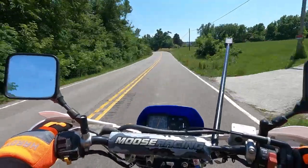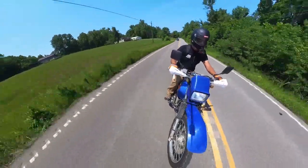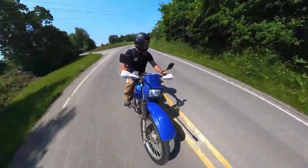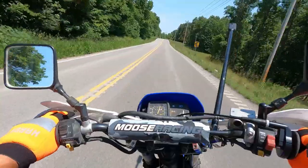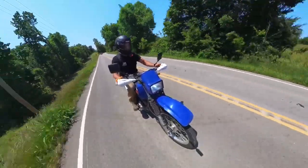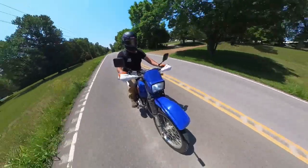The previous owners of this bike did a lot of messing with the carburetor to try to figure out why it wasn't running well, so when I pulled apart the stock carburetor, it was missing parts, it had unmarked jets, meaning they used a non-genuine rebuild kit, and in general, I'm not really a fan of CV-style diaphragm carburetors, so swapping to a classic round-slide Mikuni seemed like a good idea.